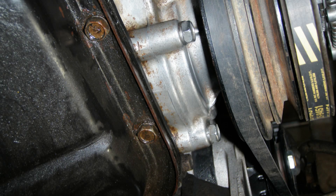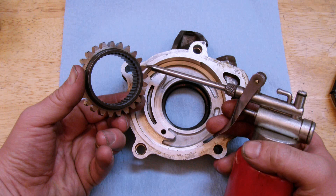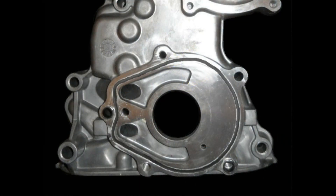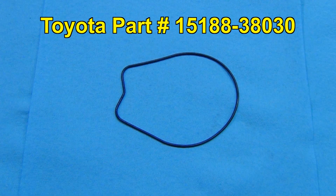Finally, you may see a little oil seepage at the joint between the timing cover and the pump body after you run the engine for a bit. That's okay — it's usually just the oil and grease that was on the surface of the pump body where it bolted to the timing cover getting squeezed out. If it continues to leak after a few trips, I'd suspect the o-ring didn't seat correctly in the groove of the timing cover and got pinched. If that's the case, you're going to have to pull it apart again and put another o-ring in.